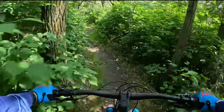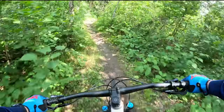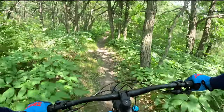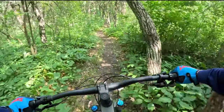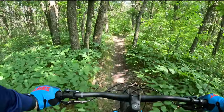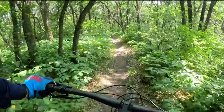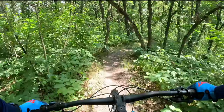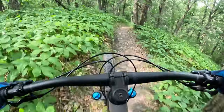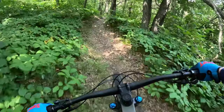Sure, paint chips aren't too bad, but eventually you get metal chips, and it really starts wearing away and sandpapers it away. Because your chain will slap around a little more, you don't have as much suspension, you're a hardtail, you only have limited gears, it does just bounce around. So this is honestly more important on this bike than it would be on the bigger, fancier bikes with higher chain tension, wider gear range, everything that makes it a little more higher performance. This requires it almost more than the higher performance ones.